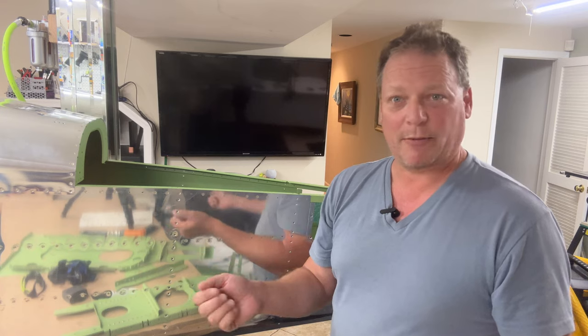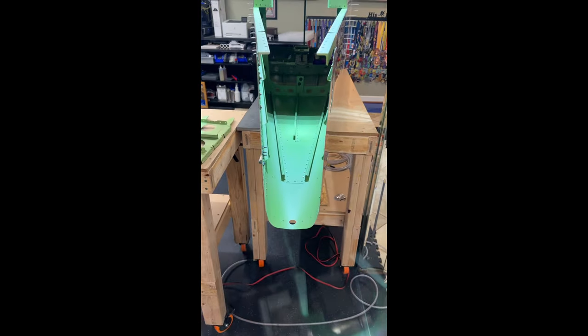So yeah, three hours — not so bad. From the tail cone coming in from the very rear, everything looks good. The rivet holes came out really well all the way up the sides. I had to remove the screws for the rudder cables — they were just a little bit long. When I pulled the 11 bulkhead out, it came backwards on this side, but here you can see where I'm not terribly impressed — some of these skin holes got widened. I don't like it, but this is actually that rear skin, that little cone-shaped piece, which I've ordered a replacement on anyway. We'll see how we can salvage that, or I'll probably just upsize to the next rivet. But yeah, 10, 11, and 12 are removed. Not so bad — everything looks salvageable.